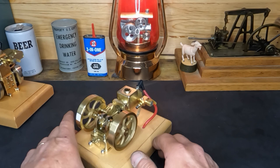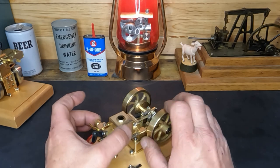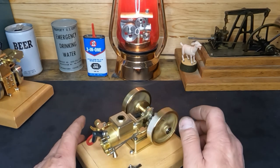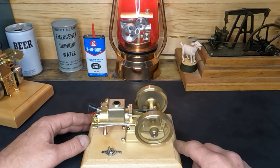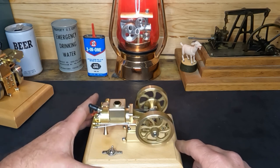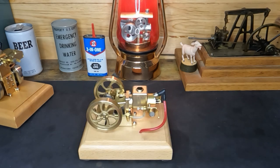We're going to take this carburetor off, but before we pull that off I guess we want to see if it'll still run. There it is — you guys see it. We'll give it a little bit of throttle, choke it here. So yes, we do know that it still runs. We'll shut it off, get our fuel line and stuff off of there, get this carburetor unthreaded, put that other one on, and put a new fuel line on it.